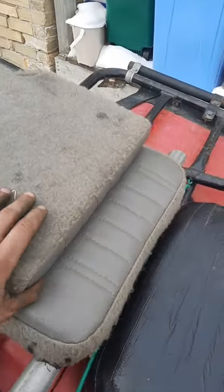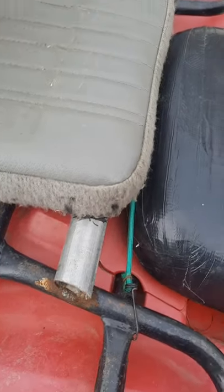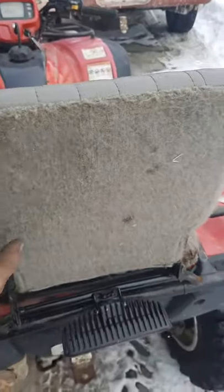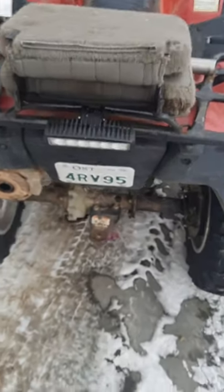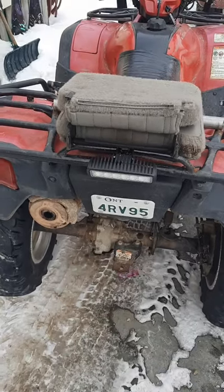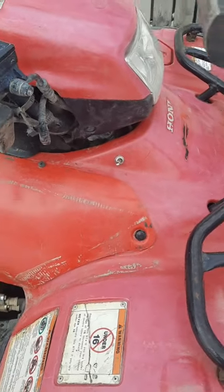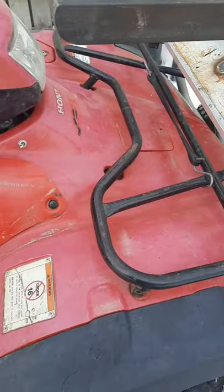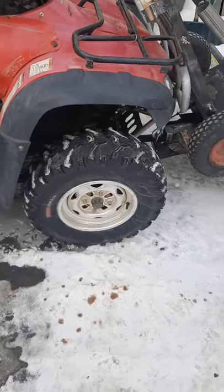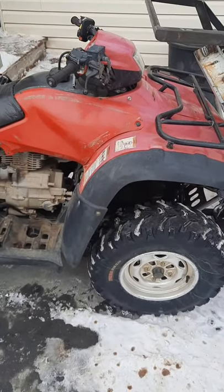I added a buddy seat — that's actually a corner back seat out of an 03 S10. I welded a piece of pipe to the bottom, tacked it on back there, and it's good and sturdy — not going anywhere — and it folds up out of the way. I also added a reverse light wired into the reverse light circuit on the dash, so when you put her in reverse it comes on and goes out when you go forward. I wired in a toggle switch so I can turn it on all the time, but it's wired into the key so I don't drain the battery. Oh, and I put new tires on it and new front wheel bearings — but that's just maintenance. Overall pretty happy with it. Thanks for watching.